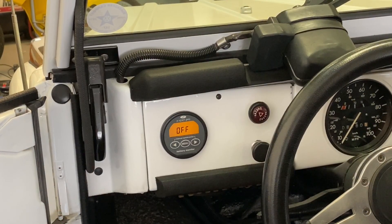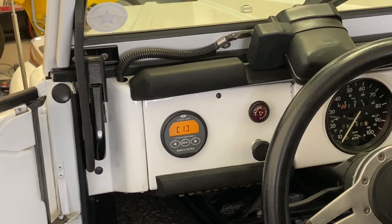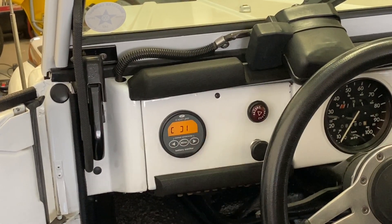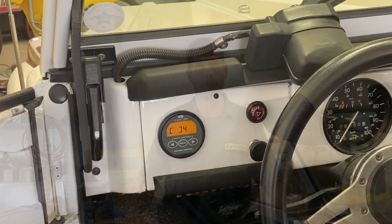We realized we missed a detail on how to determine which relay an alarm triggers. In setting 3.5, the default is off. Changing the selection gives you parentheses with the numeral 1 inside, which represents the internal relay. A number outside the parentheses represents an external relay in the expansion pack, and you can change the relay number to correspond to the terminals on the box. For low-voltage events we typically leave those to the driver, but when charging overnight, we set a high-voltage limit 1–2 volts above charging voltage so the relay can shut down the charger if the charger algorithm fails to stop at the proper voltage.